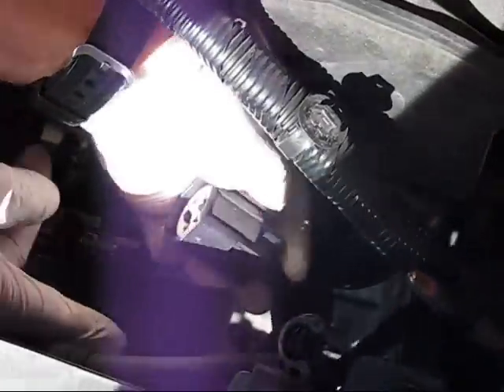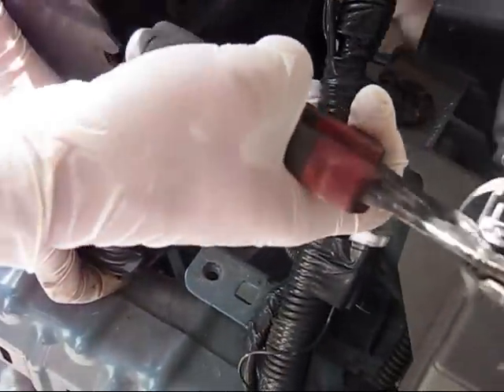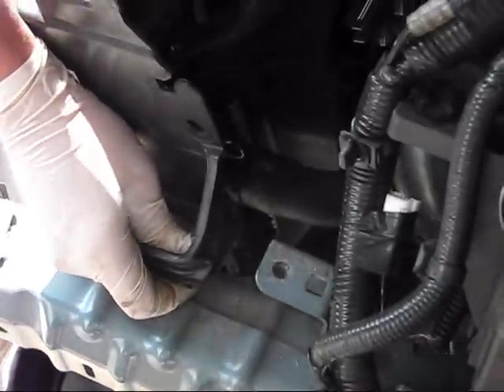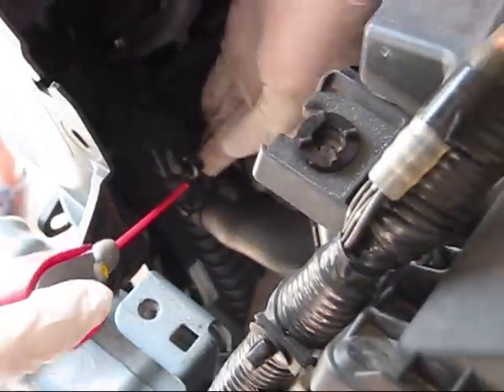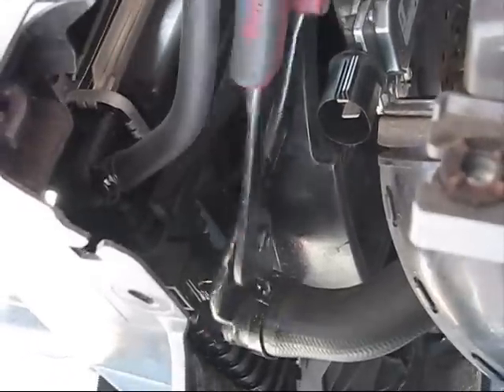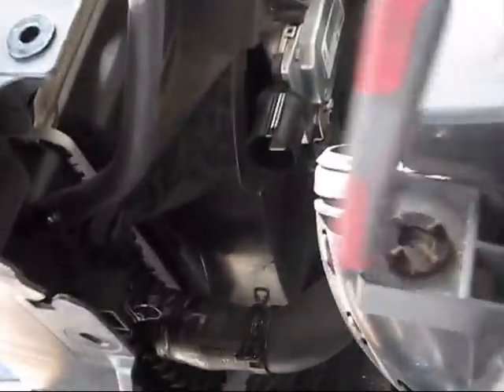Disconnect the electrical connector from the fan by tapping with a flat screwdriver or fingertips. When you've disconnected all grounding points and confirmed it's free on the right side with only the hose left, position the drain pan underneath. Remove the clamp using pliers — first put the ring up to squeeze it. Use the big pliers here; the ring is up. The big pliers made the labor perfect.